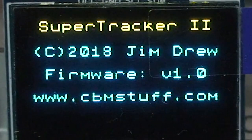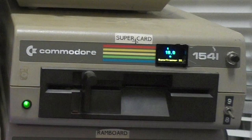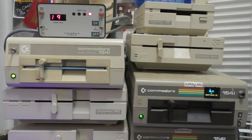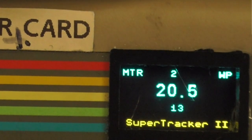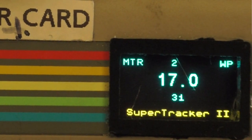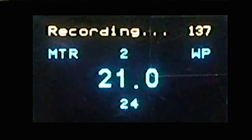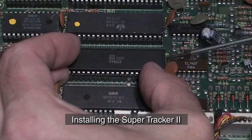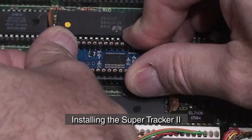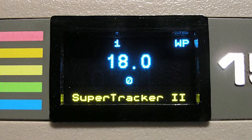The SuperTracker 2 is the second-generation display for the Commodore and most cloned disk drives. Almost 30 years after the original release date, with many Commodore users asking Jim for a new display, he created the SuperTracker 2, released around April of 2018. It uses an OLED screen instead of LEDs, showing motor state, write-protect status, track including half tracks, density, and number of syncs on a track. It also offers the ability to record and play back up to 1,500 changes in track, density, and syncs. Unlike the original, the SuperTracker 2 is a simple plug-in board that sits between a VIA chip and the disk drive's motherboard, making installation fairly straightforward.